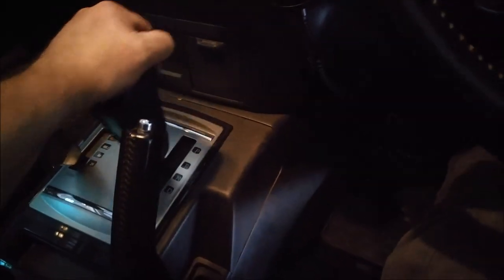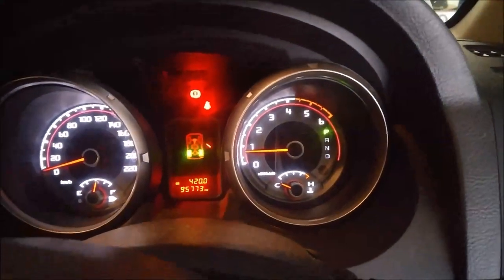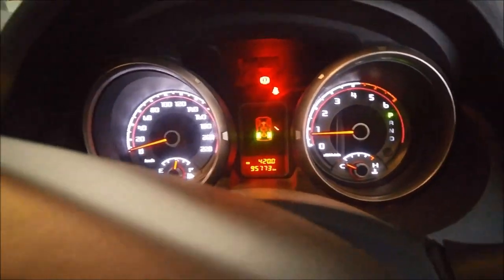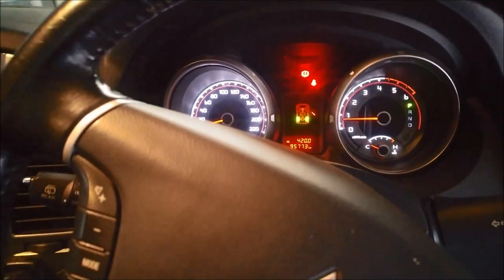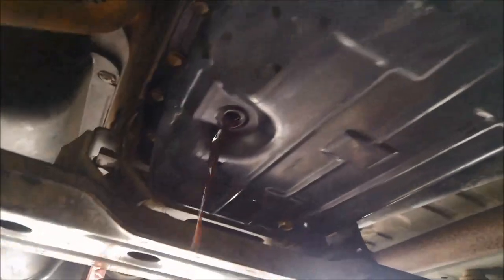Selected all the gears, handbrake on hard. Just select through the gears and back in park, then we can hop down and check that fluid level. There we go — it's just dribbling out now with the motor running.